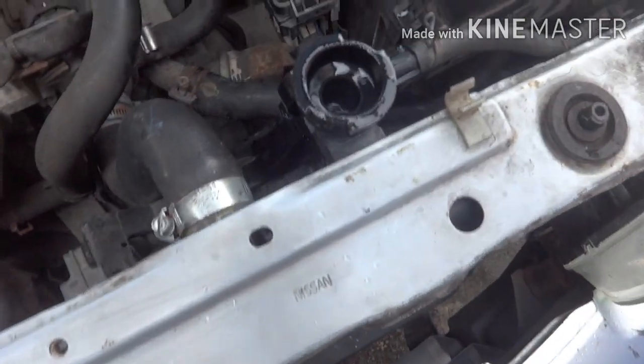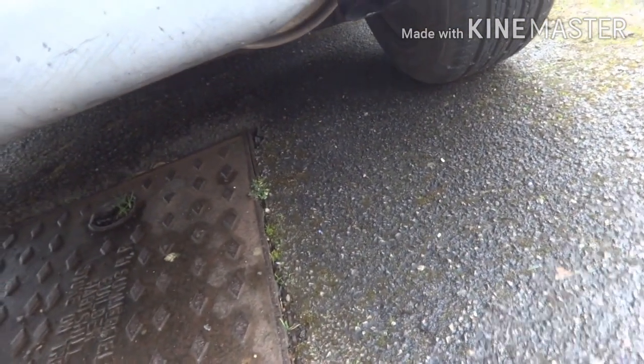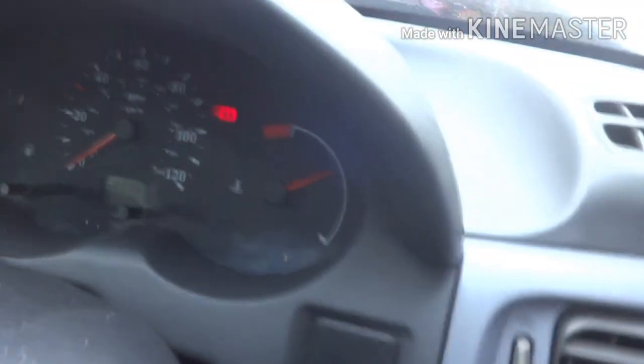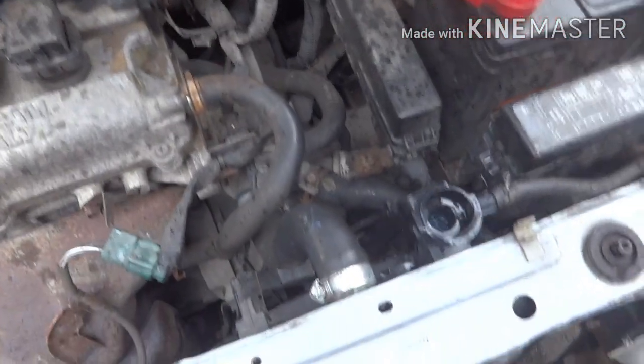This is day two. Let the car cool down overnight and just taking it for a little run. It's up to operating temperature at the moment, hasn't overheated, the gauge is pretty steady. I'm getting the occasional bubble out of the radiator and there's still some exhaust smoke. Going to the back - very little indeed, not as much as it was but it's still not completely disappeared. Temperature is pretty much rock solid. Might cycle it a few more times, but at the moment it's better - not quite fixed.